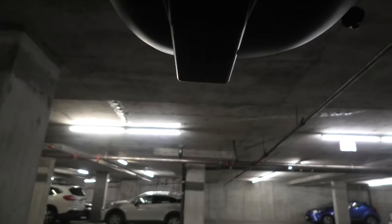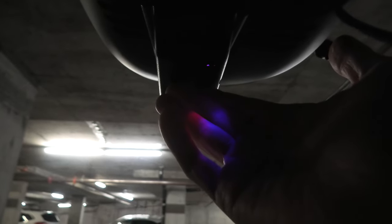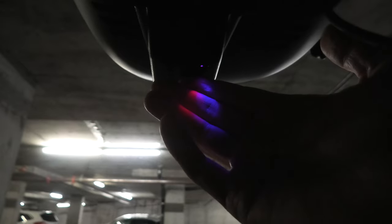To insert it, you have to follow the same procedure. So let's say right now, to turn it on, just simply press once. I did press it, I believe. Yes, we can see the indicator lights again. So now, as I said, each time you enter the vehicle, the dashcam gets the power immediately. So before you put it back in, you have to follow the same procedure. You have to turn it off. One, two, release. Now it's off, and now you can put the SD card back in. After you did that, simply press the power button once, and you'll see the indicator lights again.